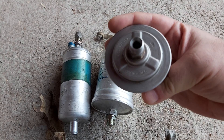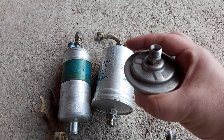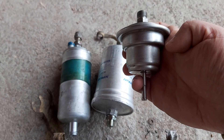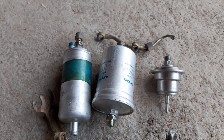When your car temperature is above 60–70 degrees C — and look here — there is no way you can open and clean this. Inside there is only a diaphragm, a rubber diaphragm and a spring, and nothing else. This part costs a bit, but you will have to replace it. No repairs are possible. This part fails at approximately 100,000 miles or 150,000–160,000 kilometers, and then it has to be replaced.